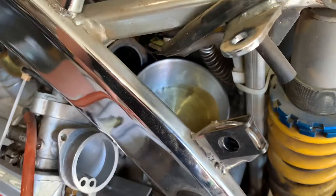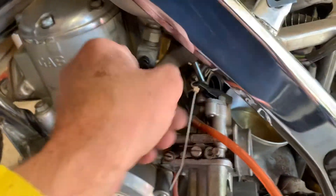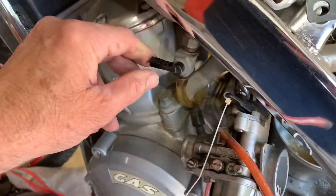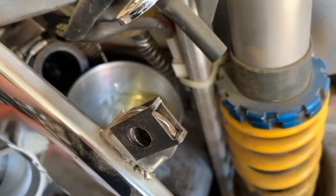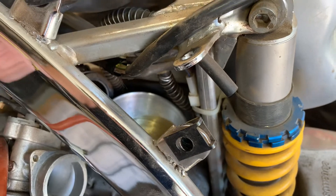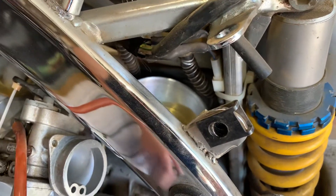What I found was the petcock won't turn off. There's the little whatever — it's dripping. It's turned off. I believe off and down is regular and still not doing much. I'll turn it all the way forward and it drips a little faster, but might need a new petcock. It's in the off position but it still keeps leaking.